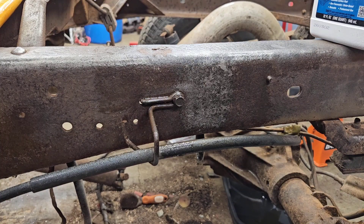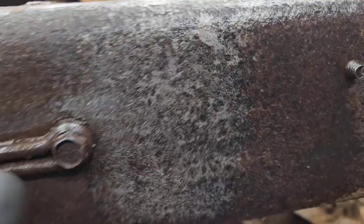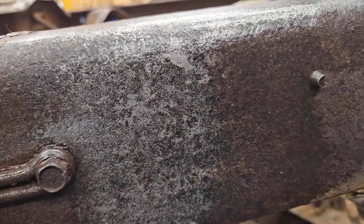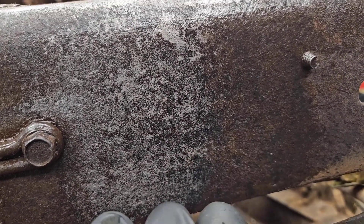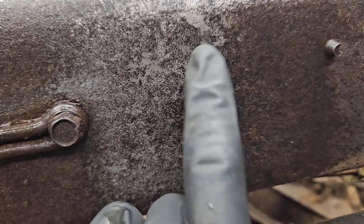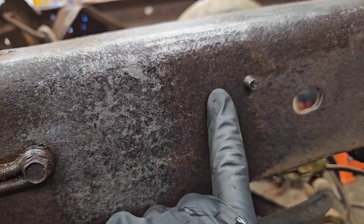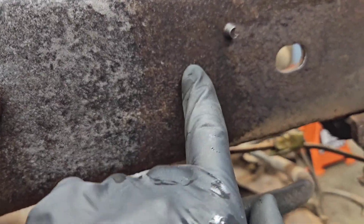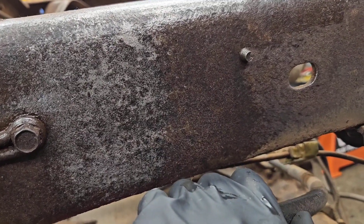Now that we have this cleaned up, you guys can see we are very, very bare metal. I do like this — you can see right where the acid drooled and you can see the before and after. So far I am rather impressed. It does take some time though, because you are supposed to wait 20 minutes between intervals and it does take a little bit of labor to scrub the frame. I am going to switch to a hyperlapse. If you guys have any questions about POR-15, don't forget to leave a comment down below. Without any further ado, let's get to it.